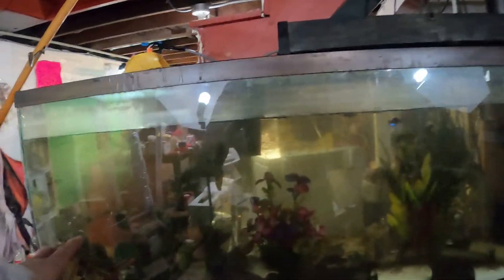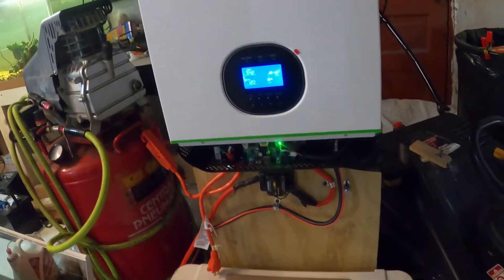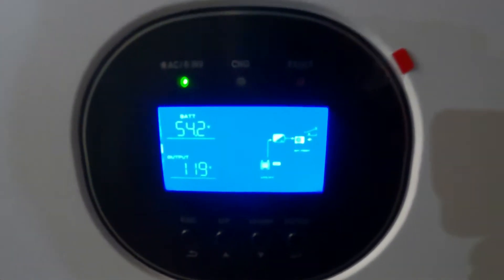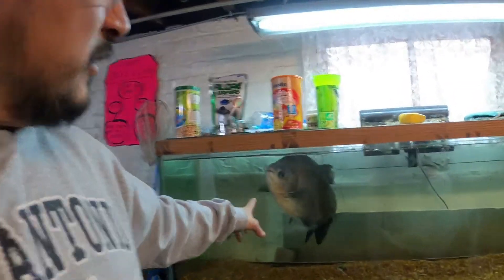It's actually not a fish tank — it's a crab tank, a marble crayfish tank. I've got the filter on, there's a heater in it, a battery charger, and a deep freezer, and it's all plugged into the Growatt right now. It's all running off the battery — the Growatt inverter is still showing 54.2 volts. Deep freezers don't use a lot of power because you rarely open and close them.